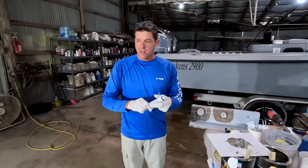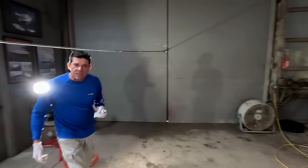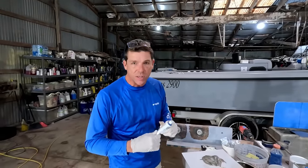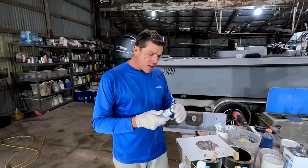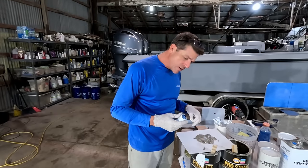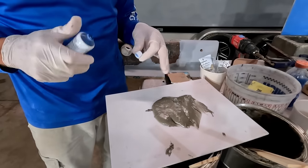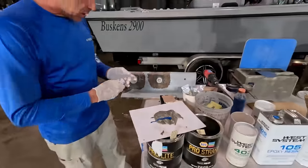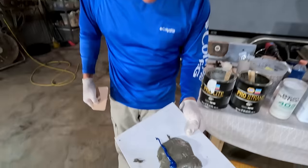So today, let me check our temperature. We are holding at about 65, 66 degrees. Maybe some of you folks, I want to say that's in the mid to high teens as far as Celsius temperature. So fairly mild. This putty though, the hotter it is, the faster it's going to cure. So you'd want to put less of the activator in it if the weather's hot. Now, generally speaking, if you have a little serving size of putty about this size, I find about one line slightly off center is going to be plenty. Matter of fact, that might even be a little on the hot side.